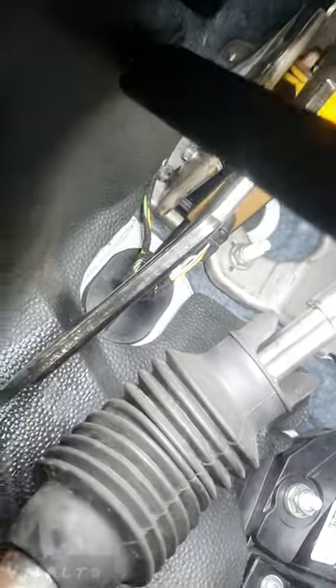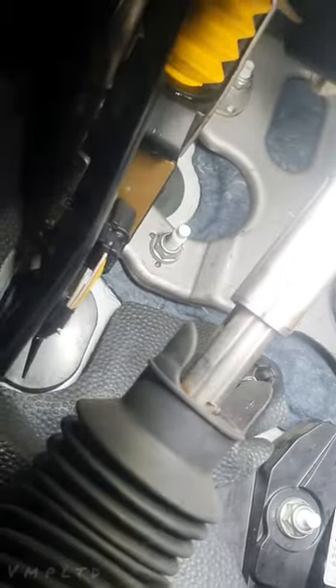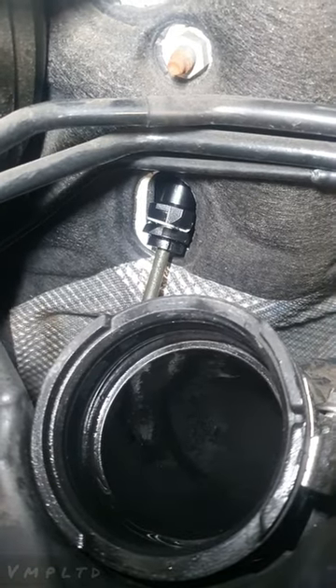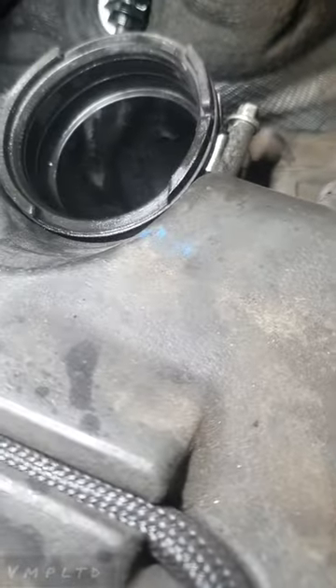You press it that way - one mouth is higher and one mouth is lower - so one way will release it and the other way will lock it back. They're ideal for those type of clips. Inside you can see a 10mm bolt there on the edge of the clutch pedal. Just inside you can see that little web, a little yellow plunger, the gold-colored surface, and then you've got the plug. Remove that plug, then you've got the two bolts, and if you take off the hook from the outside, the next step should just be to carefully pull it towards you and that will release it.